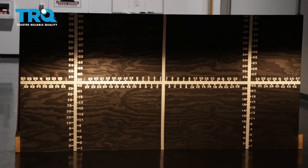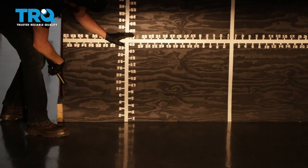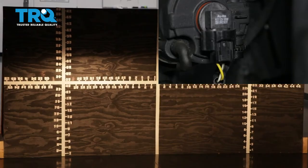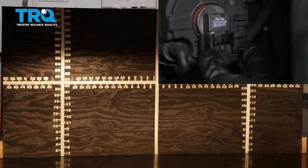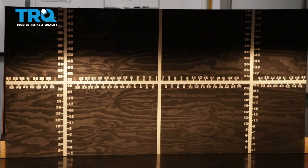Once your headlamps are properly adjusted, it'll be time to adjust your fog lamps. You'll notice on the driver's side the focal point is all the way at the bottom right now — I'd like to bring it up so it meets approximately the bottom of the focal point of the headlight. Some fog lamps have an adjuster; others don't. The ones that do have an adjuster, you would just turn the adjustment to the left or to the right to adjust the beam up and down to where it needs to be. Now with your TRQ headlamps and fog lamps properly aligned, you can drive down the road safely.